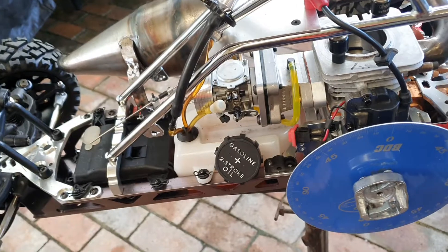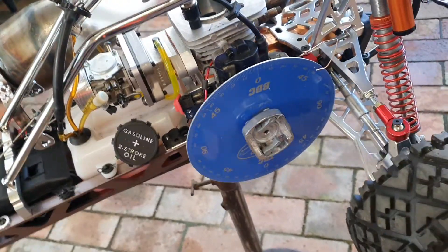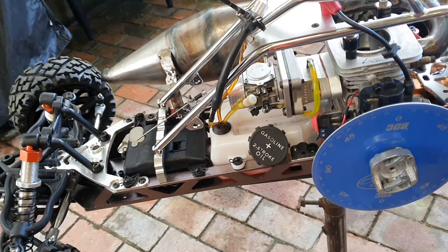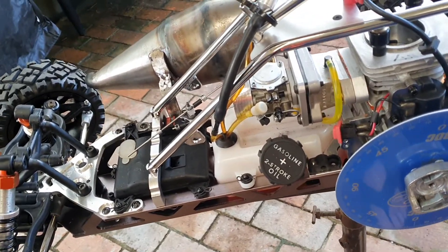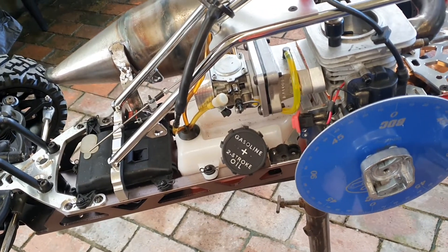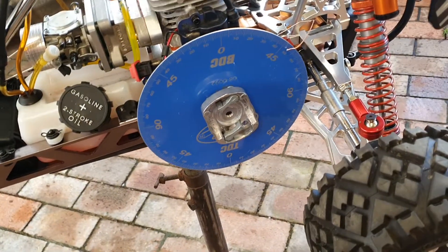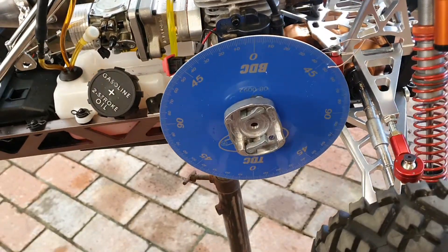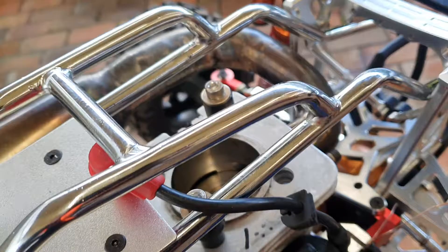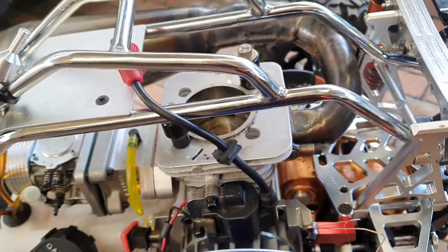The port work and timing is correct. With the last reed block I couldn't get it on the pipe - not so bad. With this reed block it made a big difference straight away; I was ballooning the tyres on the rims. The rest is just going to be fine tuning on the oval - a little bit more rich on the idle, because the plug's running clean. That's how to use the degree wheel, how to zero it in, and how to check your blow down and get the numbers. Alright guys, I'm out - see you next time.